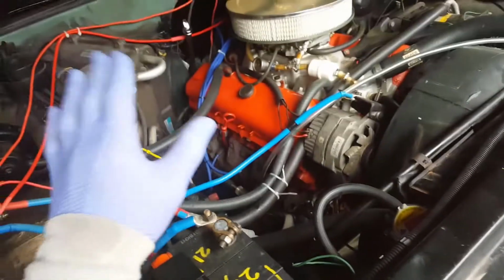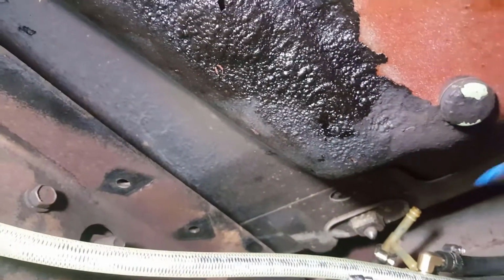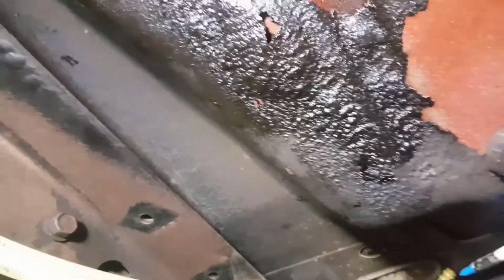Also, in the early stages, the tank vent was clogged. So that's the tank vent line there. I'll have to do something better than that, but that could have been an issue. I'm not sure. Just the back of the tank here, that through there, that's the tank vent line. Don't know if that'll show up. Probably won't. That there is the tank vent line. It's got a T. That's the tank vent line from the right-hand tank, the left-hand tank there, and it comes out in a T, and that went up to the engine bay and vented there.